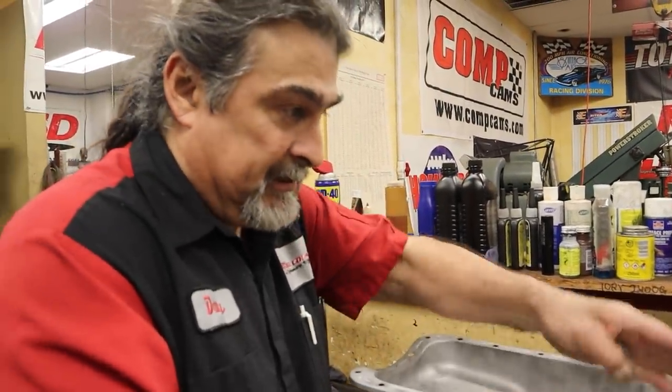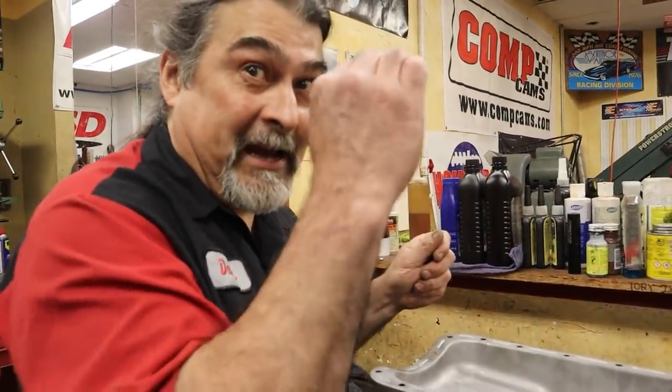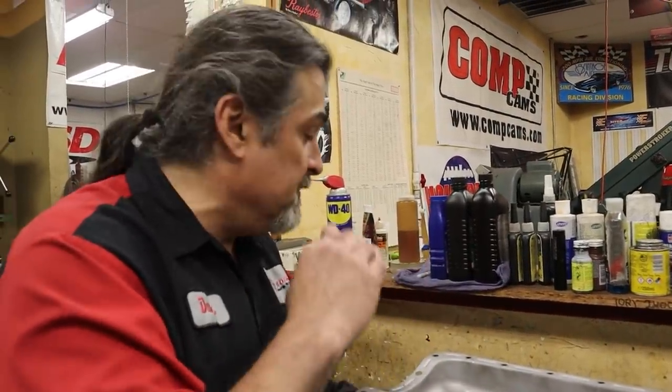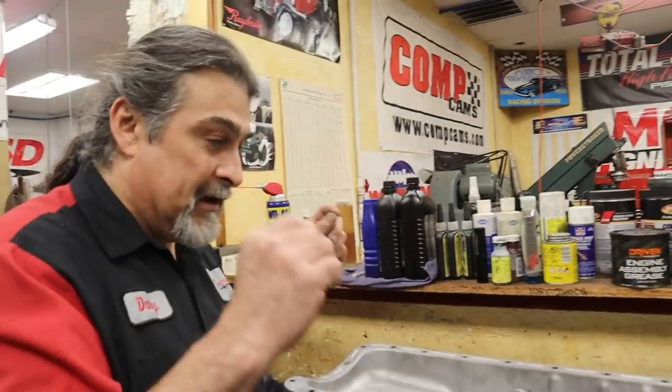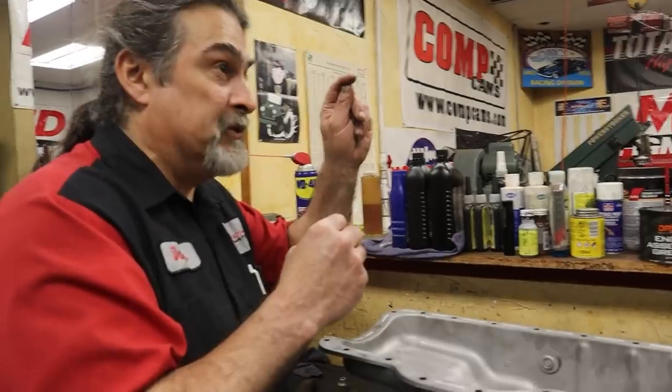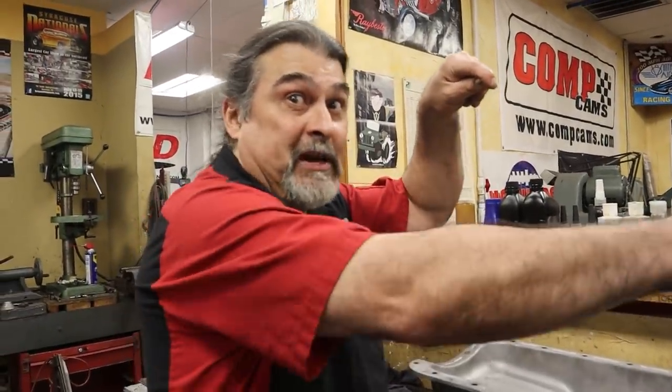Everybody thinks, well, it's in the oil pan. No. Yep. If it's underneath the oil, it'll smoke like crazy. Yes. A perfectly brand new, most expensive turbo in the world cannot hold oil pressure. Right, because it's a gravity drain. It's not meant to have... Everything, when there's oil pressure going in, it'll push it out the bottom.